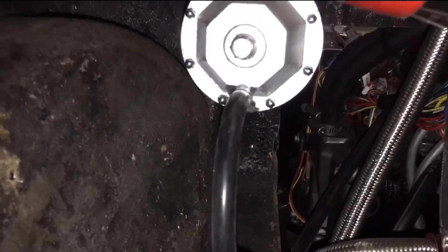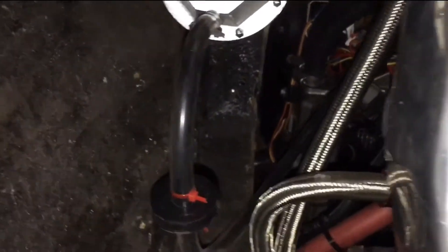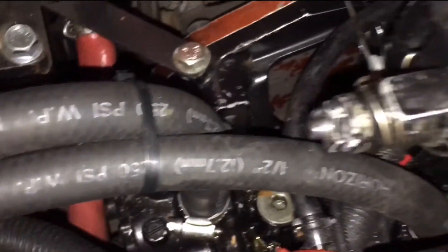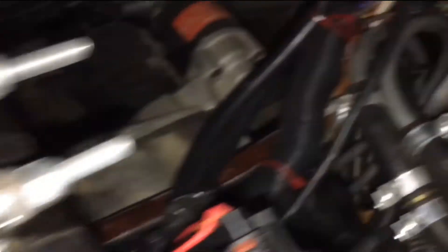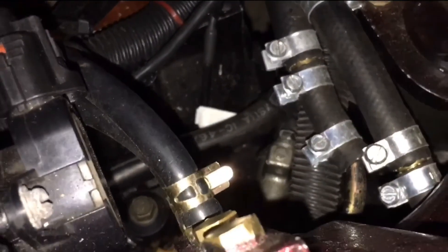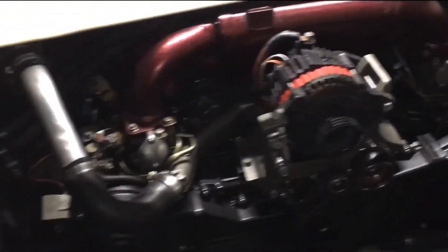I got that pulled out, going directly from the blow valve to the intake manifold now. I'm going to pull the line for the boost gauge back and it'll plug into one of these ports on the back of the intake manifold. The fuel pressure line tees in over here right now, but I'm going to move it up into the intake manifold port so it's for sure getting the correct amount of fuel pressure for the motor.